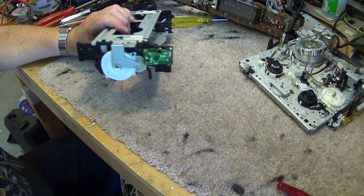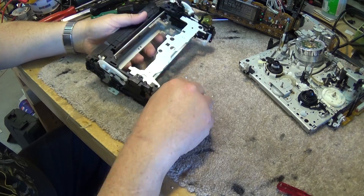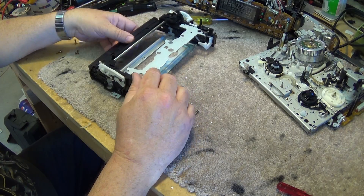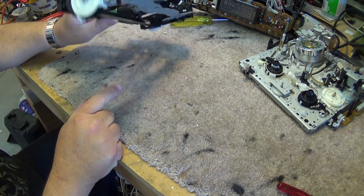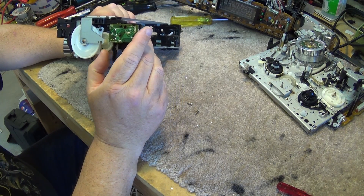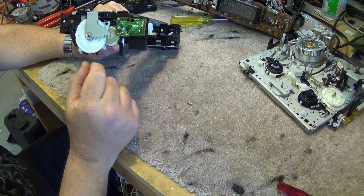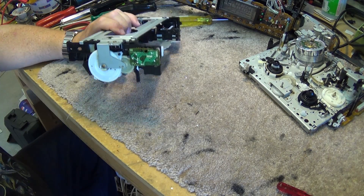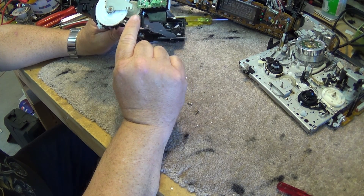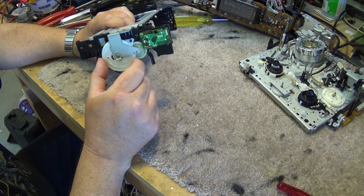The first thing I'm going to look at is the front loading mechanism. It's pretty straightforward - it's just a mechanical arm that is connected from one side to the other. There's a gear down here and we've got two other gears. There's another gear that meshes on the side of the main cam. When it's instructed to load and unload the tape, it engages through a little clutch assembly and turns this gear which in turn loads the mechanism.